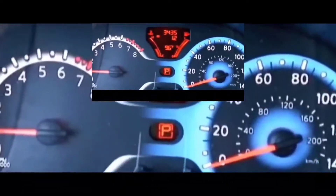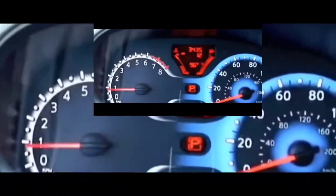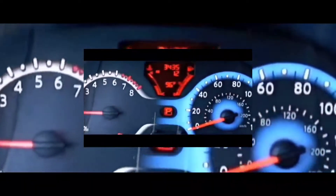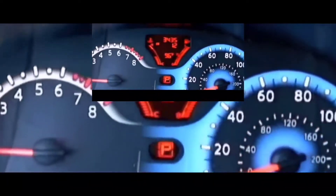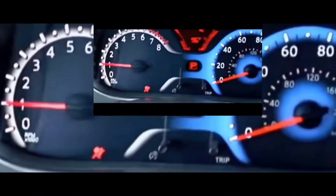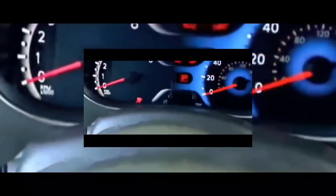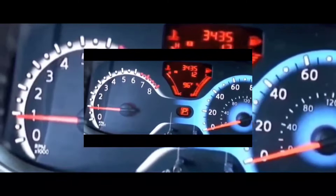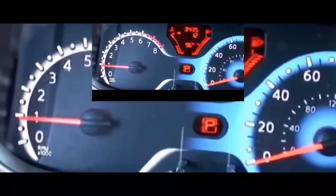I was thinking, I did change the battery, maybe it's the battery causing it for whatever reason. Everything worked — the headlights worked, and it cranked strong. So I opened the hood and looked around the battery area to see whether there was any corrosion. I didn't think it was the battery, but I checked anyway. No corrosion, it was clean and tight. The negative line connecting to the frame was also free of corrosion.